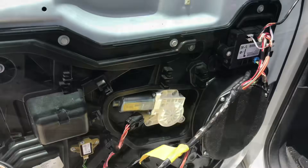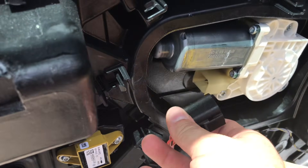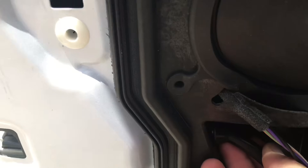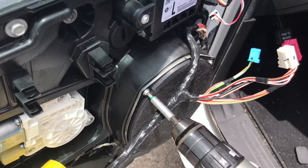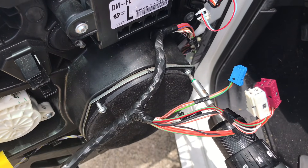The next step is to remove these wires. I've already disconnected the window motor regulator connector — just pull those out. There's also a hidden wiring harness way up in here. Remove this little piece to get access to that area. Slide out that yellow pin contraption and there's a wiring harness back there that you want to remove as well, and you'll be able to get the door panel out. To make things a little easier, use the same T20 bolt to remove the four screws and take the speaker out — that gives you another access point.